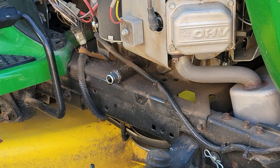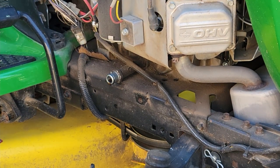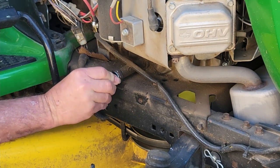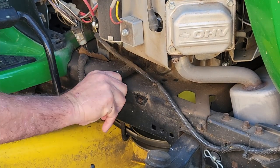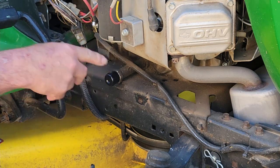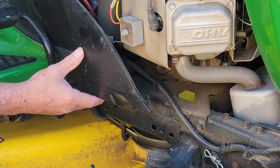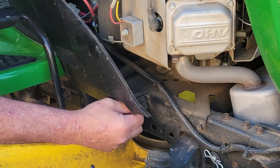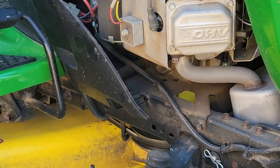Now for the rest of this we'll get in just a little bit closer. This is the cap we removed to take the oil out — you see it goes right there with a quarter turn. Notice we cleaned it up while we were waiting for the oil to drain. It takes three or four minutes for the oil to drain out. Now go ahead and put the side cover back on.